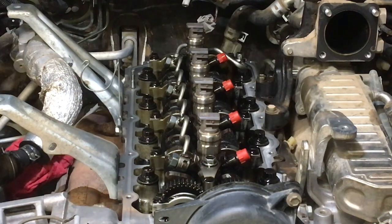Okay, so what we do later is get the vice grips, or put it in a vice if it's a prod. It depends what part comes out. You've basically got to lift your wiring loom bracket upwards a little bit, pull on it, lever it, whatever, while spinning that 10 mil still. So it's good to use an impact driver, and it'll come out and end up like that. Either way, this is what we've got to do. We don't need that piece because we're putting in a new valve cover. I'll just show you the new valve cover so we know what we're talking about.